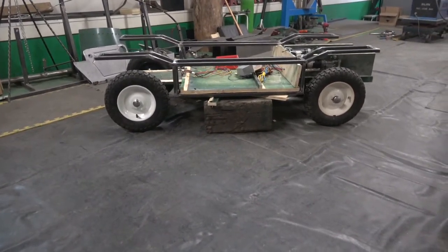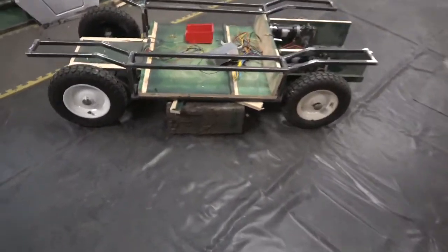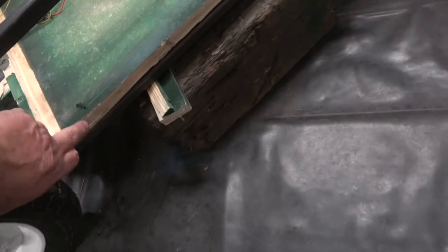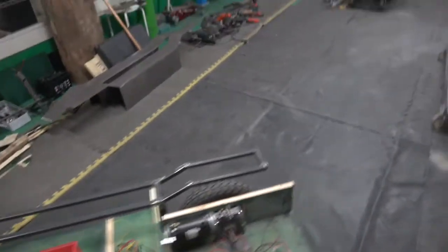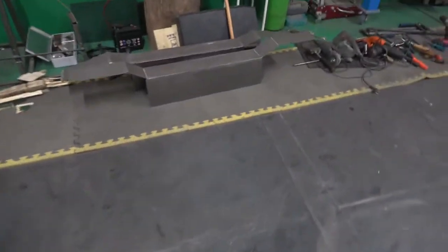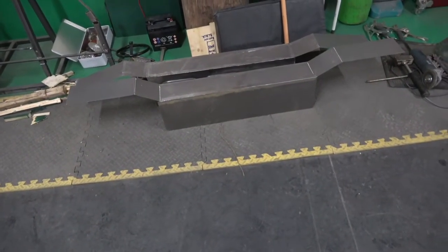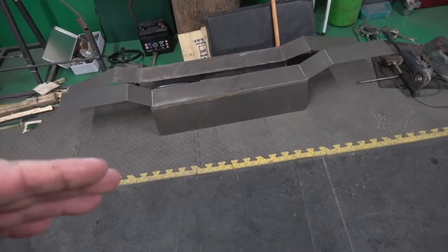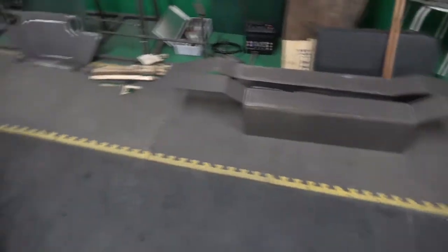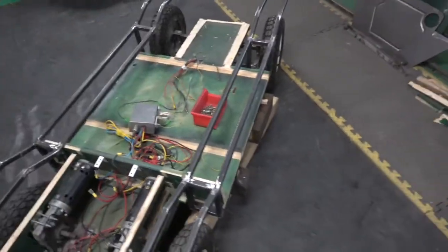I'll get them set up tomorrow. The depth is 12 on the outside, but I'll have to cut this difference off the inside. In fact what I'll do is make that a returned edge on the inside. I'll get a couple of pieces of angle iron and bolt it, and hold it with vice grips either end, and we'll just bend it up inside so that when it comes inside the car it comes down and then inside, and we'll just screw it down.